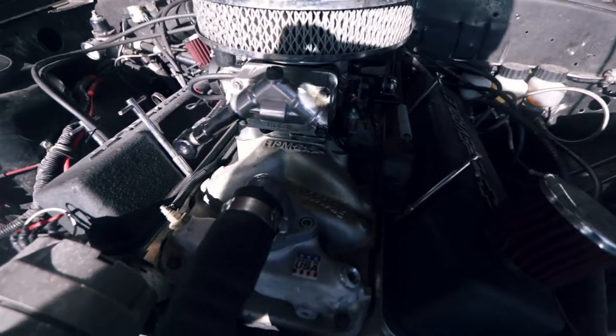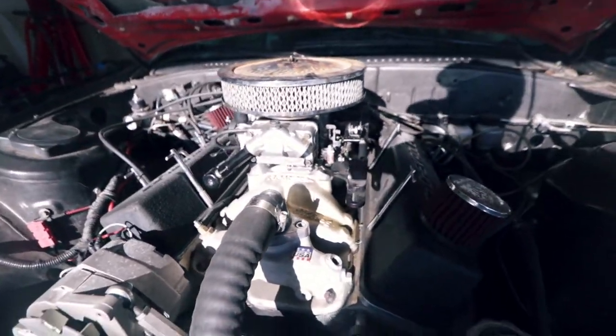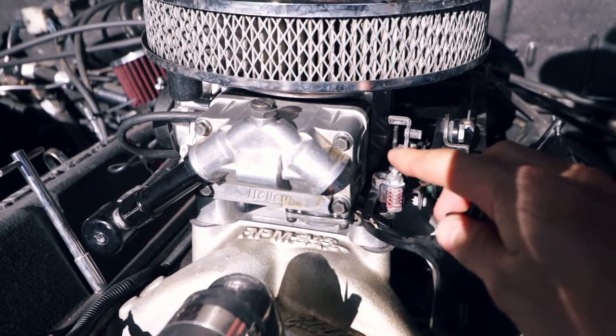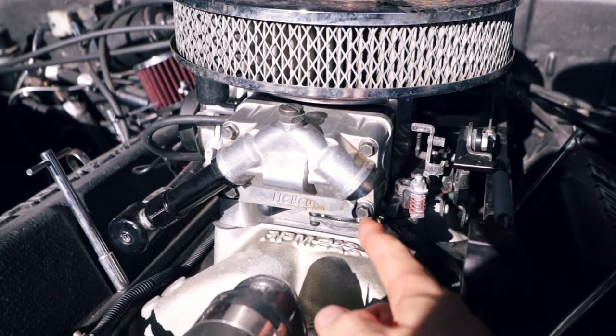On this it's just going to be two seals - I believe it's the accelerator pump seals - because when I turn on the fuel pump it starts shooting out fuel in places where it shouldn't. That's the last thing you want. I'll show you where it's at. On the Holley's we've got one here and one in the back because this is a double pumper.